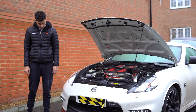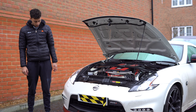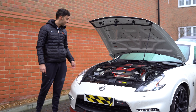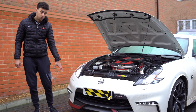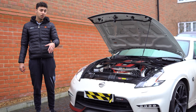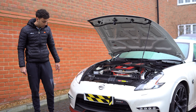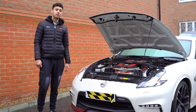That is how you do constant-on or always-on DRLs on the 370Z. Obviously they won't be on all the time - they'll be on when the car's on. In this case, they actually come on when the ignition is on, but not necessarily when the engine is on. They normally come on when the engine comes on, but here they're coming on when the ignition comes on. So if you're sitting still and the engine isn't running it might be worth turning the ignition off. But these are LEDs so they're not going to draw much power anyway.